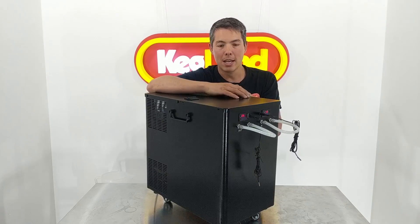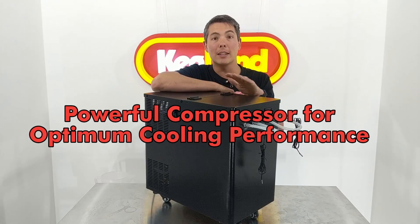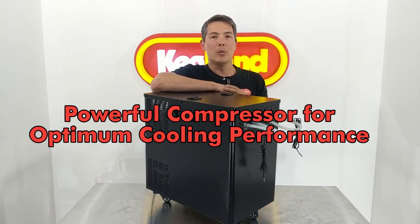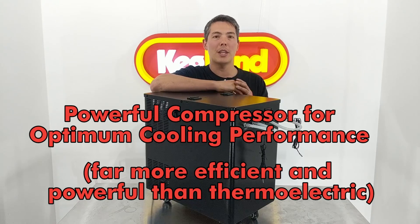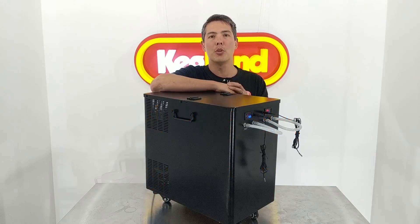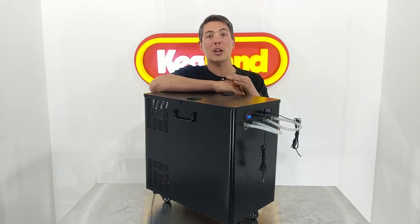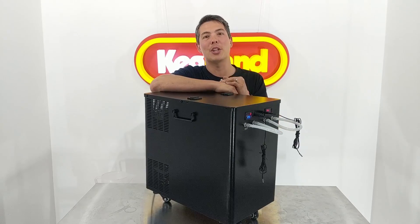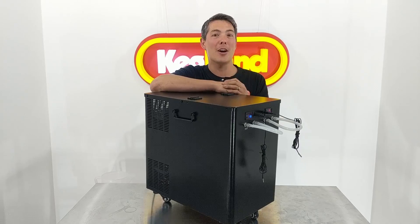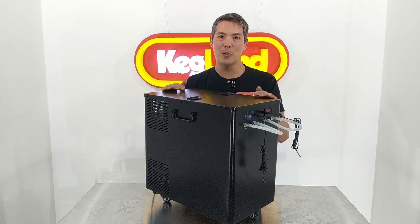This particular unit we've decided to go with a compressor. When we originally started looking at the design for this G20, we tried to get away with using thermoelectric cooling, but honestly I'm glad we didn't — thermoelectric cooling just didn't quite have the cooling performance. There are some other homebrew thermoelectric coolers which kind of keep you in fermentation range, but as soon as you want to crash-chill a reasonable volume of beer they just don't have the power, especially when the ambient temperature gets hot.